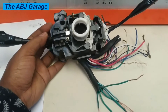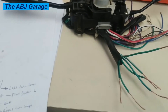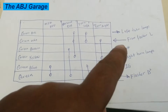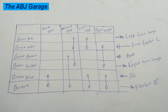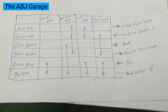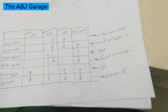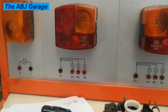In our previous video, we looked at the terminal identification for the turn signal and hazard warning light wires. We marked all the color codes and identified the different terminals. For example, green-black goes to the left turn lamps, green-white is a line coming from flasher terminal L, green-brown is a line coming from the battery, green-yellow goes to the right turn signals, and green-blue is a line coming from the ignition switch so that the turn signal switch is powered by the ignition on position. And finally, the green terminal goes to flasher terminal B. Based on this identification, we are going to connect the wiring diagram.